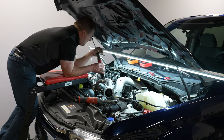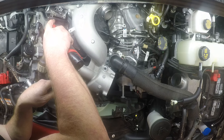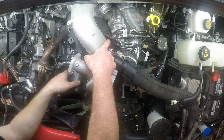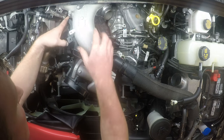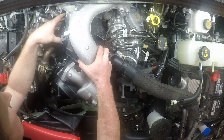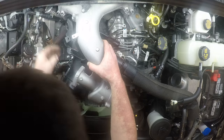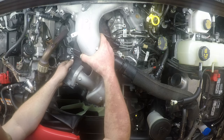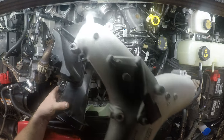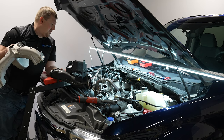Connected to the turbo on the plastic lower plenum there is a 7mm clamp — loosen that up and it will allow the lower manifold to come off the compressor. The MAP sensor can stay in; you do kind of have to wrestle these two pieces out together. This is where having the dipstick tube out of the way is helpful — bring the upper out and they really kind of come out together. There are upper and lower intake manifolds removed, which allows us to get to the metering unit on top of the fuel pump.